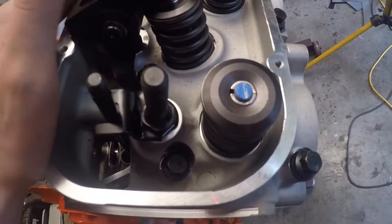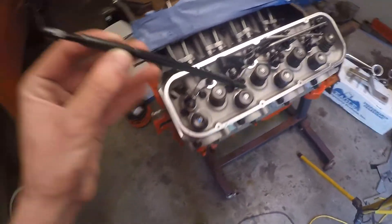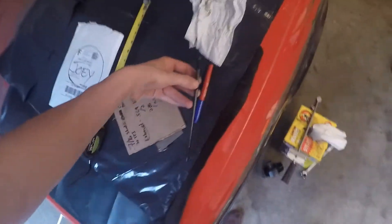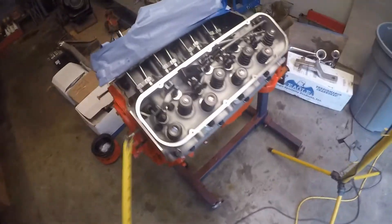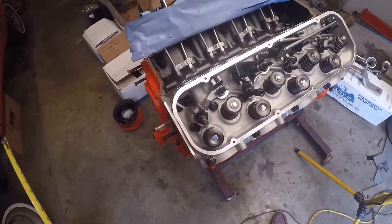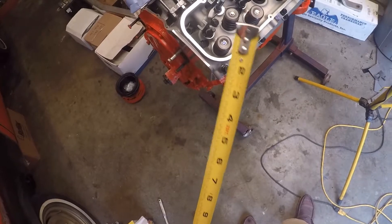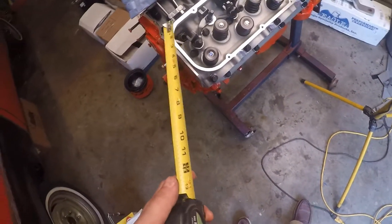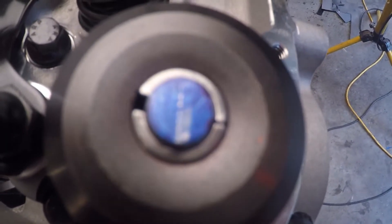So I'm going to make that adjustment and put my rocker back on to see if we made any improvement. I ended up taking a section out of my adjustable push rod — try not to spin it too much because it doesn't lock itself into place. Now everybody online uses micrometers and all these fancy measuring tools. I'm not into that — I drive an old Chevrolet and I have a mullet. Here's my Harbor Freight tape measure. The original setup was at 8 and 11/16 on the tape measure, so I dropped it down to 8 and 10/16.